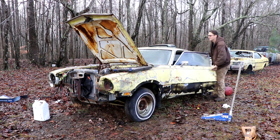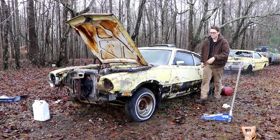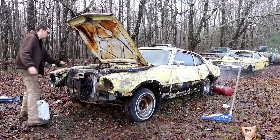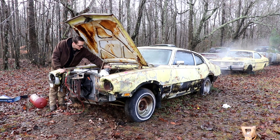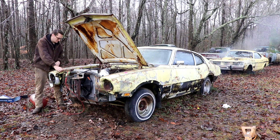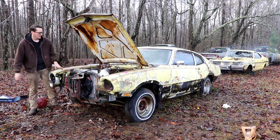I'm trying to close the choke and that didn't help. Fire it back up — here we go. Because of the vacuum leak I never fixed it. The belt is more of a shoestring now — I think we've dropped a couple of cylinders.